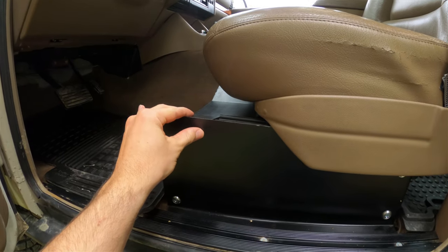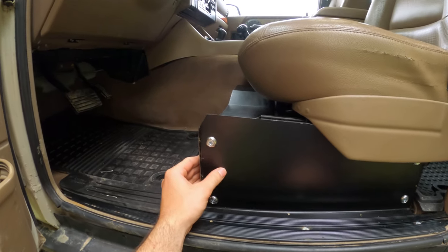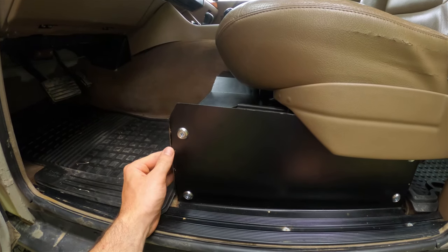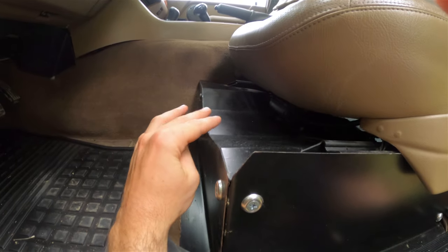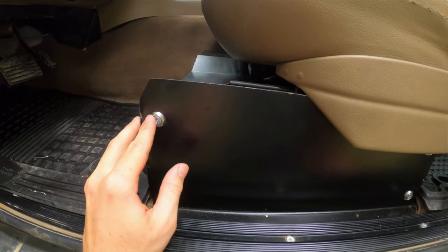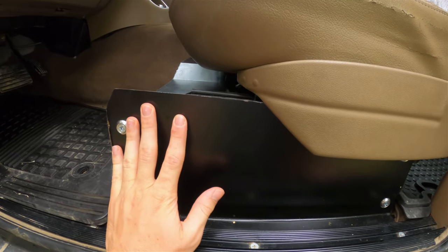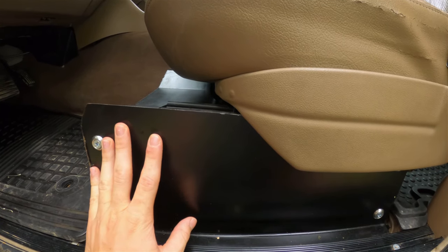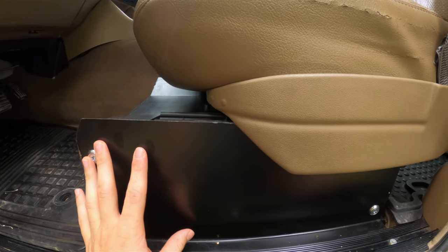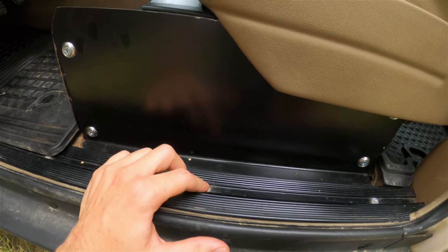You might notice the seat boxes are a little bit different. These are actually steel seat boxes that I made. The plastic ones were totally cracked and broken. So I bent up the steel all the way around and then got these fancy washers and made these seat boxes. And these are a lot nicer than the crappy plastic ones that were there. I did a bunch of other things, like I replaced the plastic nuts that they used for these with riv nuts.